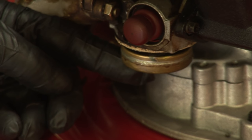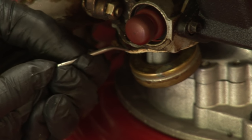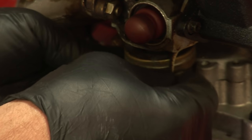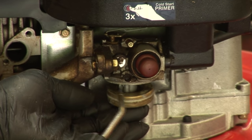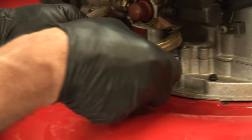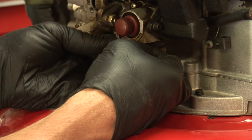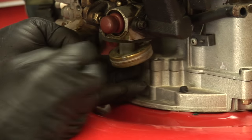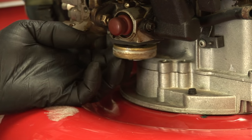So we're going to take the gasket off. Get a little screwdriver — in this case I'm using a pick. This gasket is really bad so we're going to take it off. I have compressed air so I'm going to blow that off. This is a new bowl O-ring — we're going to put this on the carburetor. Get the back on first and then work your finger around to the front, and just make sure it's all the way on.